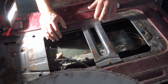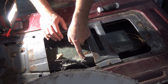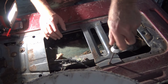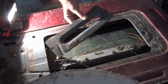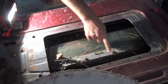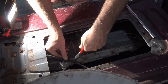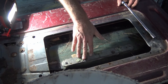To get the window out itself, right underneath this plate there's an 11 millimeter bolt here and an 11 millimeter bolt here, with two more identical to it on the other side. There's a little tab that holds it into the top of the tailgate. Now here are the two 11 millimeter bolts. For this truck, the defrost wire is already broken free from the window, so no need to worry about that. The zip tie holds it on - cut it and get it out of the way. Now we can go ahead and loosen up these two bolts and do the same thing on the other side.